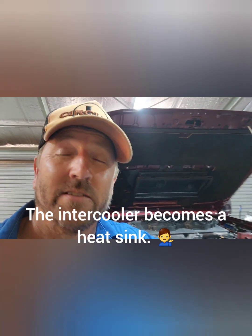So why do we even need these fans? When you're shooting down the freeway at a hundred k's an hour - or a hundred and thirty if you're in the Northern Territory - it's not such a big problem, because the bonnet scoop is scooping up all that air, they've got that rubber grommet around there, it's pushing all that air down through the intercooler, keeping everything nice and cool and keeping your performance up. But if you're in low range and pushing really hard, you're not moving very fast but the vehicle's working very very hard, the motor starts to get pretty hot and you're not getting any airflow through there. So you want these fans there, and I believe they should have probably put them on from the factory. Most owners put them on after. Thermostat kicks in when it starts getting too hot - they're pretty high-powered fans so they really force a lot of air through that intercooler and start to cool everything back down again. And that is the reason most of us put them on there.